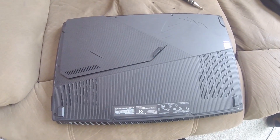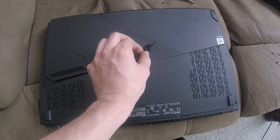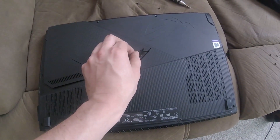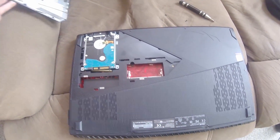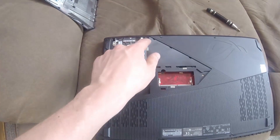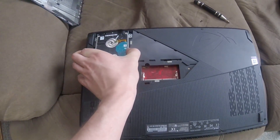To take your laptop apart, you're going to want to pop this rubber little flange, and there will be a screw under there, removing your accessory panel. From there, you're going to have four screws here, and you're going to carefully remove your hard drive.